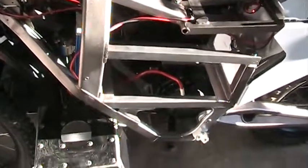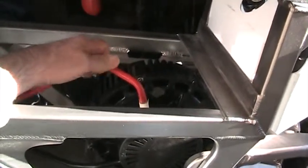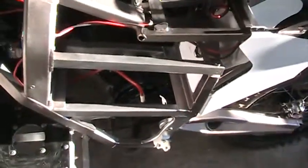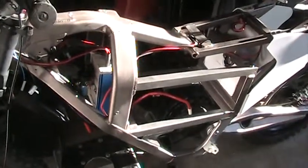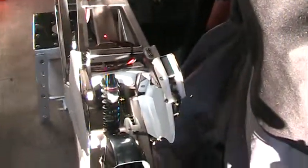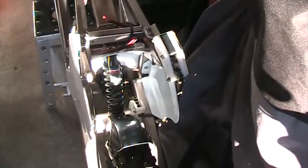In this case I'm wiring it up with some fairly heavy gauge wire. You want to use 4 or 6 gauge — 4 is better, the thicker the better. You're going to want to use high quality connectors. I actually like to use gold-plated contact connectors because they don't oxidize, so they don't get hot spots and ruin themselves — which I learned from using Wilderness Energy electric bicycles. These tend to really burn up any connectors going into the Kelly controller. Regular SLA batteries are not so good either: the contact is very small, they get hot, they oxidize, and suddenly you've got a hot spot.